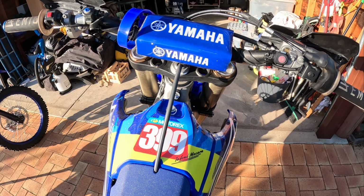Comes standard with bark busters, so not full wraparound, but these are pretty sturdy. Comes with toolless adjustable damping on the front forks. Nice little dash setup. Got your odometer reading there and your speed, obviously. The fuel tank is a little bit smaller capacity this year, so it's 7.4 litres compared to 7.9 litres. It's got a little fuel light that comes on with 1/3 left and no reserve. Just like the YZ, it's got the map switch, so you can pull over, put it in neutral and change maps on the fly. So that's whatever you've preset the maps to be in your power tuning app.